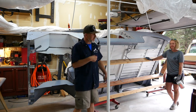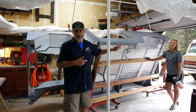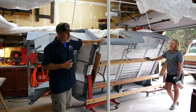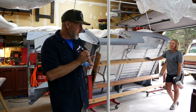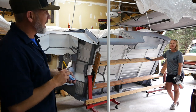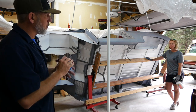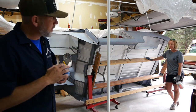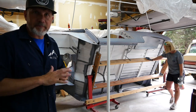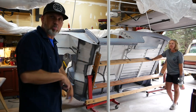And now we're going to let it dry overnight. Actually, I take that back, we're going to tape off everything that we're not going to put bed liner on, and then tomorrow morning, once everything is dried out and the seams are dry from all the water, we're going to spray the bed liner on, and then that part will be over. Then we're going to reverse the tape and prime the truck again, and then we're going to paint. Here we go.